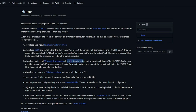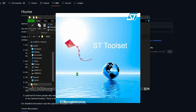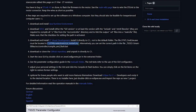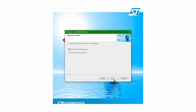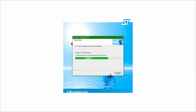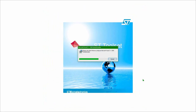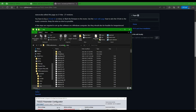Now, the STToolset — remembering to install it in the root of the C drive. First, let's extract the setup and launch it. When it asks where to install, we'll just browse the path and remove Program Files (x86) from it. Let's also install the drivers. We can check if it's the right location by copying the path from the wiki and pasting it in the address bar of Windows Explorer. Yep, all good.